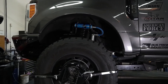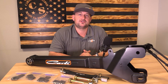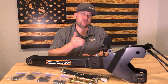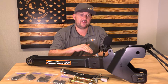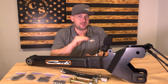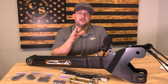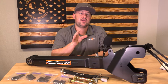We knew it wasn't going to be exactly one, two, three, and four degrees. With the four and a half inch lift that John has — using the four and a half or five and a half inch kits that we sell for these Super Duties — those have our radius arm drop brackets, so the arm is basically parallel to the ground. When you use a two and a half or three and a half inch system, the arm comes from the factory location, leaving it at a slight angle, which means slightly less correction. With the neutral shims in place and the factory radius arms, John was sitting at 3.5 and 3.6 degrees of caster — not bad. The radius arm drops are doing their job.